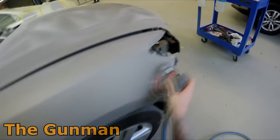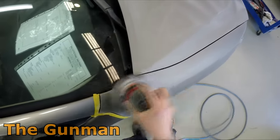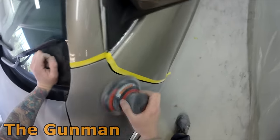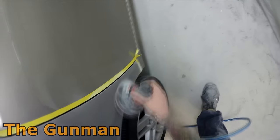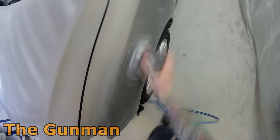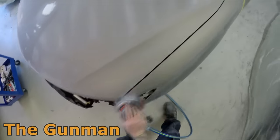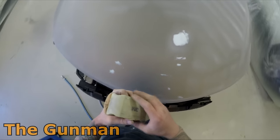I must admit I don't usually do this next stage — I was mainly doing it for the video — but if you do find you get a few sanding scratches, you can put that Abralon disc onto your orbital and give it a final pass. That takes it from 800 right down to 1000 over your blend areas. I've heard some people use that waterborne cleaner — the methylated spirits and water mix — on the orbital too, but to me that's wet sanding and it'll start flicking water all over the place and making a mess.